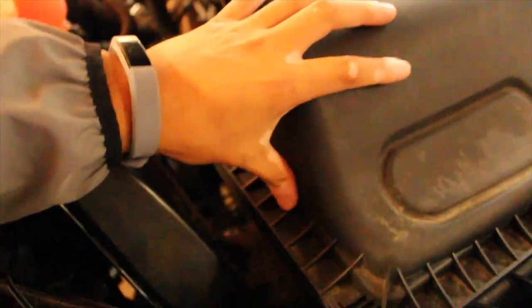The one thing I'm a little hesitant on is connecting the turn signal cable and reaching access into the headlight wiring harness because there is literally no space whatsoever to get access down there on the passenger side. I need a child's arm to fit way down there. But if you look on the driver's side, all you need to do is just remove the air intake box — just this bolt over here. Be careful, you do have a wire that is attached to the box. But once you got this thing removed, oh my gosh, I could literally move in there. Look at this massive space you have when you remove the air intake box.